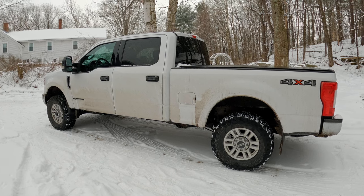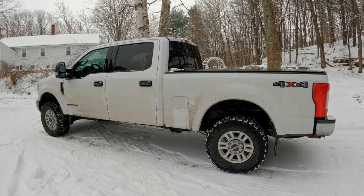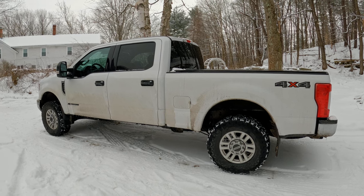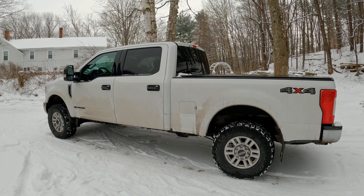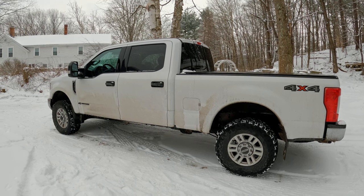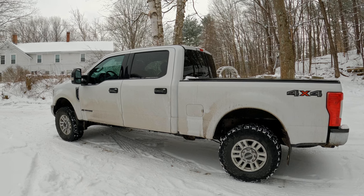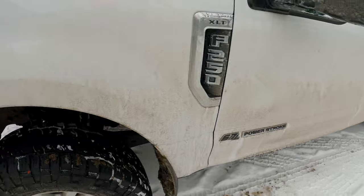So again, replace your shocks - it will really help the ride quality. It will not soften the ride - I want to make that very clear - it will not soften the ride of your Super Duty if you do shocks, but it will help with body roll and cornering. If you hit an expansion joint on the highway, your truck won't lurch crazily side to side. Shocks are huge, and for $800 you can replace all four. Get the Fox 2.0s; you will not be disappointed.